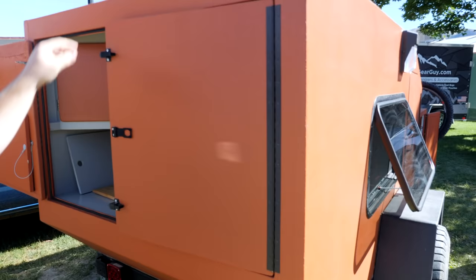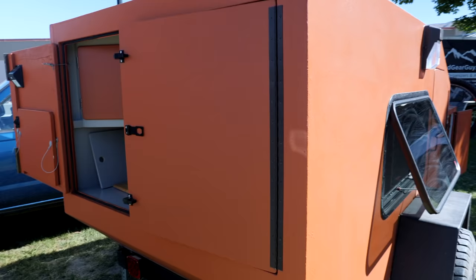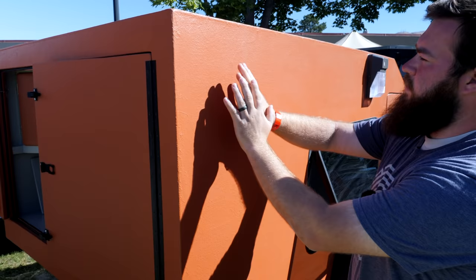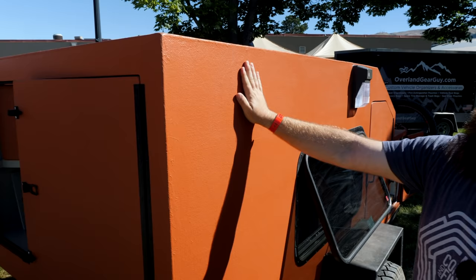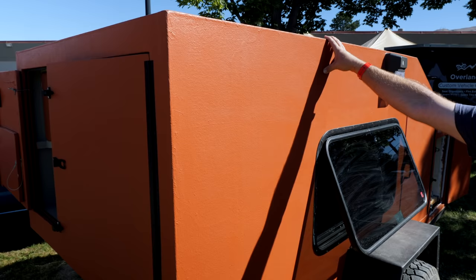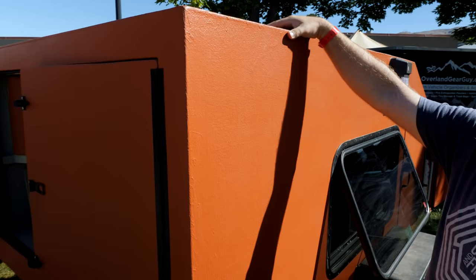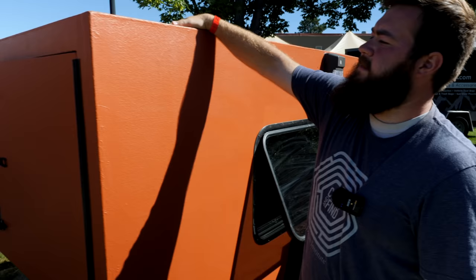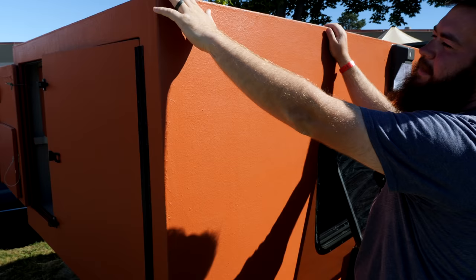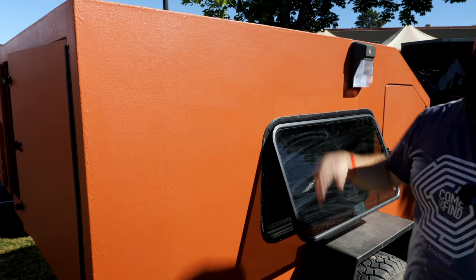How about ease of use — was that a hard process? I was a little worried at first, because something I noticed on a lot of trailers that do poor man's fiberglass is they'll do the sides first and then do their top pieces and wrap them over, and you get kind of an ugly line along the side. I really, really didn't want that. So to avoid the line, I wrapped the sides and took them about two to three inches over the top. Then the top piece comes right to this edge — you keep it right on the edge, take a razor blade and cut it, then work it and smash it down with the glue. The edge almost becomes invisible and you still have a ton of overlap on top. It looks great — really clean.